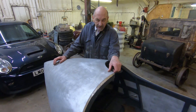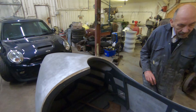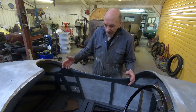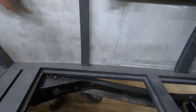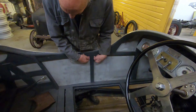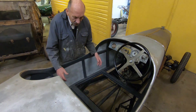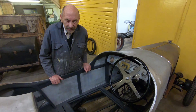They had to put a little piece of metal around the edge because when we pulled it off the old nails were gone. When they put the tail on and the front on, apparently you couldn't do it in one piece, so they had to put the front on, put the back on, and then weld it on the car — which is a fabulous job when you consider they couldn't burn the woodwork. The woodwork is made in beech because originally they didn't use ash like we do, so when this bodywork was made they had to go and buy beech specially.